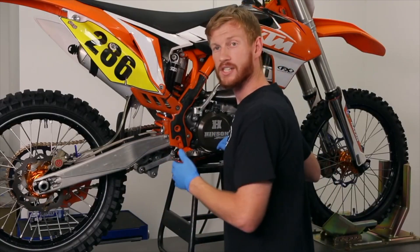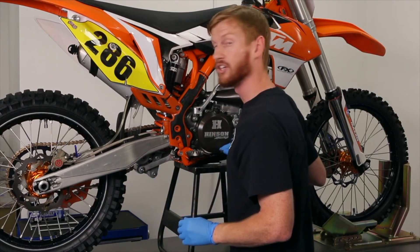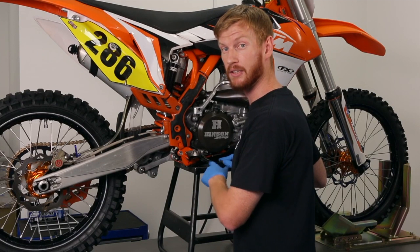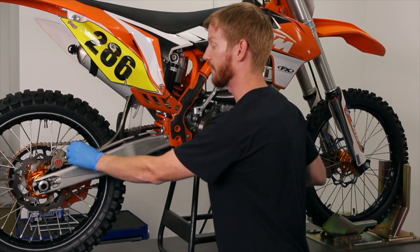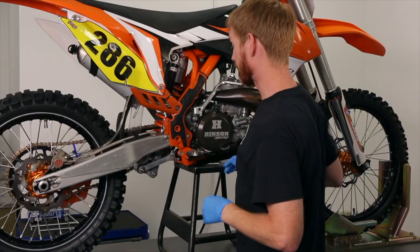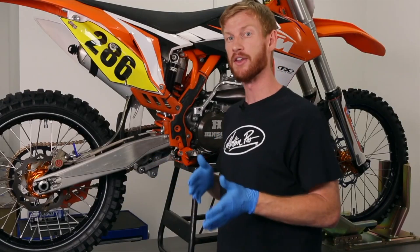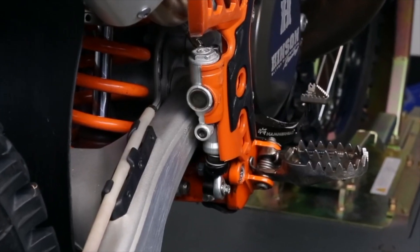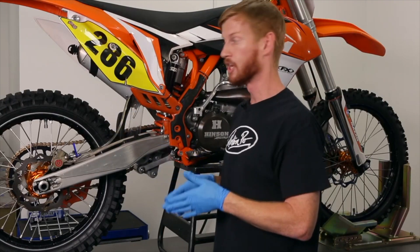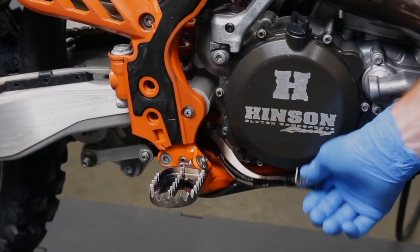At the end of the process, monitor the fluid level in the master cylinder and pump it down until the fluid is right at the maximum fill line. On the last pump, hold the brake pedal down as if traditionally bleeding, then close the bleeder off with the integrated anodized blue handle. Now the pedal can be released and you can check for a nice firm feel. If the feel isn't firm after continual bleeding, there may be some other damage within the braking system. We have other tools available for caliper and master cylinder rebuilds, because a properly functioning brake system should have a nice firm feel after this bleeding process.